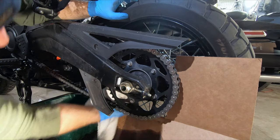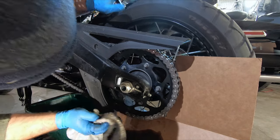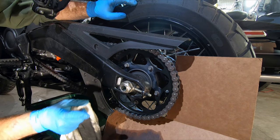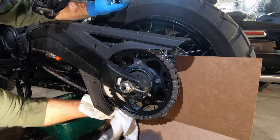This is a good time to be inspecting your sprocket for any signs of uneven wear. Basically, if any of these teeth start looking like saw blade teeth — where they have a little bit of a curve to them — then it's time to be replacing it.